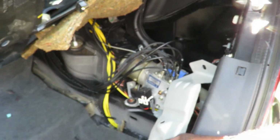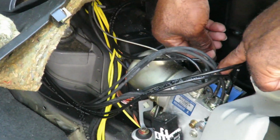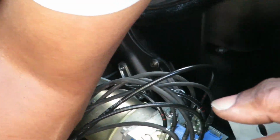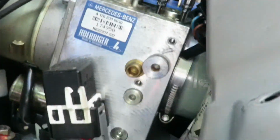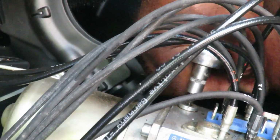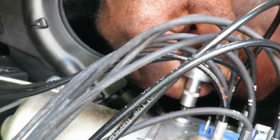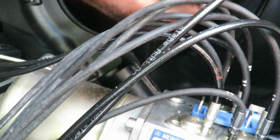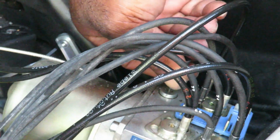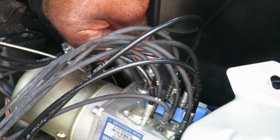Now, what you're gonna need now is, I should have it out here, a 5mm hex bit socket. And you see it goes right there. And I'm gonna use my 1/4-inch drive ratchet. These bolts, this bolt right here sometimes is kind of tight, so make sure you have a good hex bit socket. And that ain't gonna happen because that one looks like, dang it. Oh man, that's right. Somebody replaced the cylinder on this, so I don't know if this one, let me get a little hammer, guys, and tap this in to make sure it's nice and tight. Be right back.